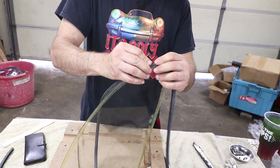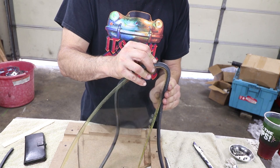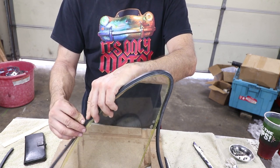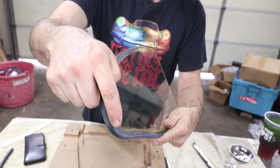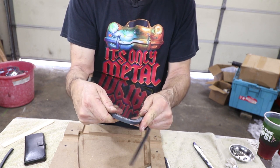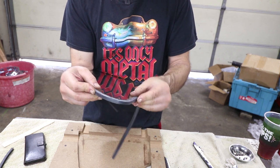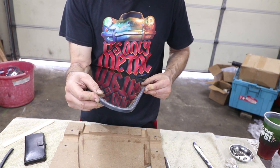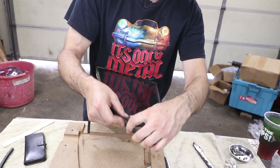See what it's like going around this tight corner here at the top - I guess this is the back of the car. This glass really does spread the seal out quite a bit, so it's a little bit of a challenge to get this on here. A lot of people say just to use soap, but I'm going to fit it dry first to see how it likes to buckle right there. I feel like what needs to happen is it has to stretch out - you need to create extra space there at the top as it bends around so there are no wrinkles. I feel like it might be better to put this on dry so it really grips the glass, and then when it goes into the channel we can put some lubricant on that.